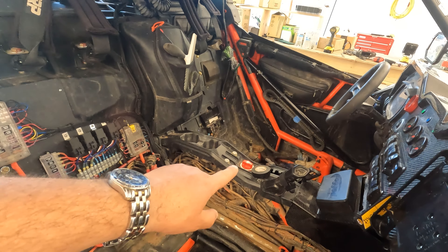Got the crank stopper in there and pulled off the magneto basket. It was a 14mm Allen that turned it, and it was definitely helpful to have somebody slowly twist that while somebody else looks through that tiny hole and waits for the gap in the crank so you can thread the stopper in. Then threw the Motion Pro puller on there — works super good, link in the description below — and popped it right off. That center bolt is a big M16 torqued down to about 140 foot-pounds, so be prepared to really give it a good reefing.